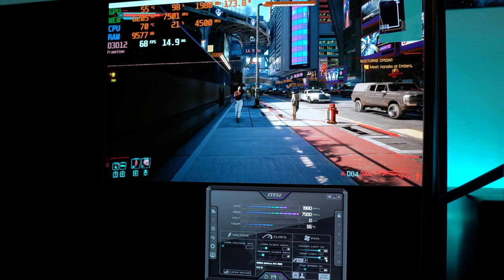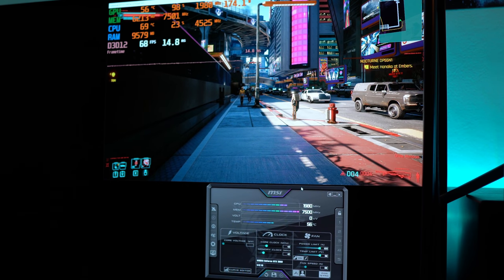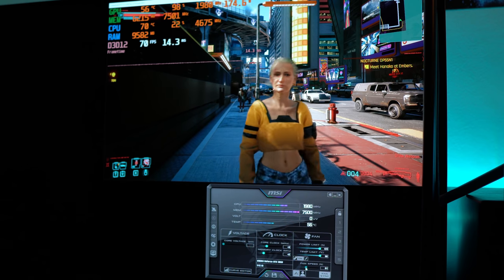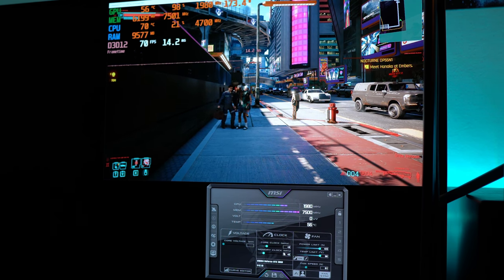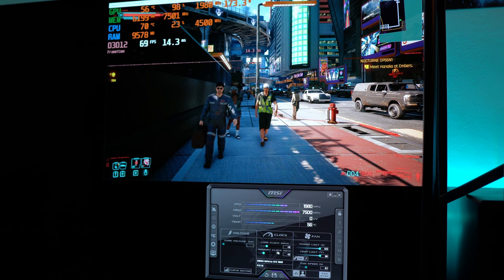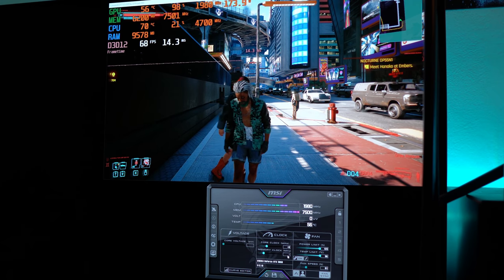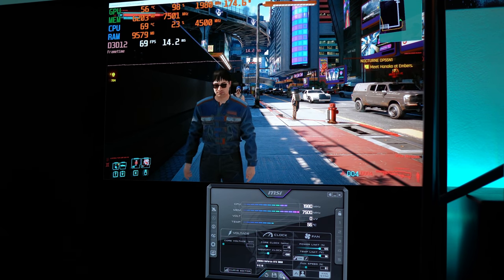Even though I allowed the temperature to go to 90 degrees, it's still under 60 — we're in the mid-50s. That's the thing about putting this ridiculous Strix cooler on this RTX 3060. I'm going to leave the fan speeds where they are because it's already running really cool, and I can still barely hear the PC. Let's play around with the actual clock frequency — we've got the memory clock and the core clock. Generally, you don't want to just slide it all the way to see what happens, but you can take your first jump pretty far. I'm going to go 500 on the memory and click apply.